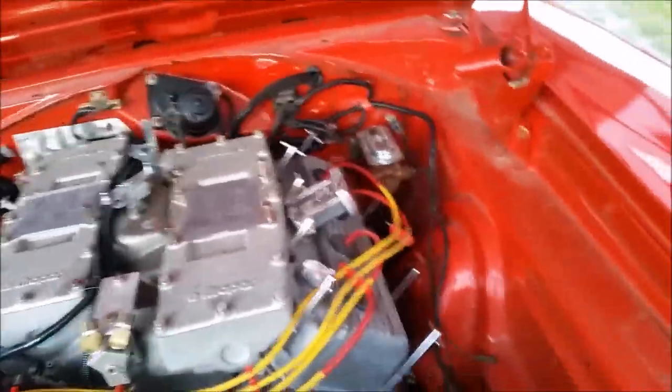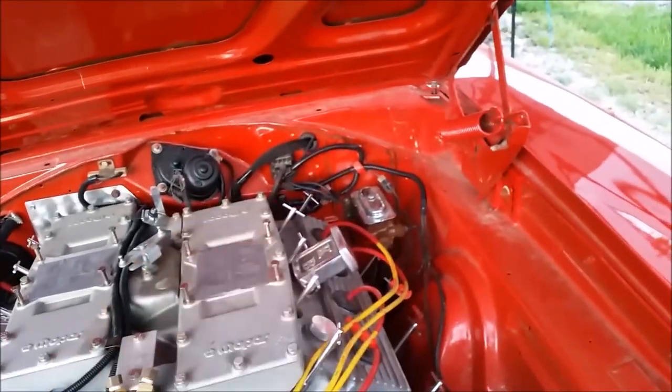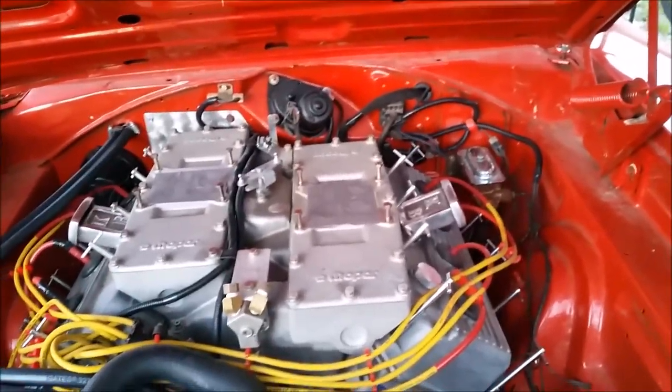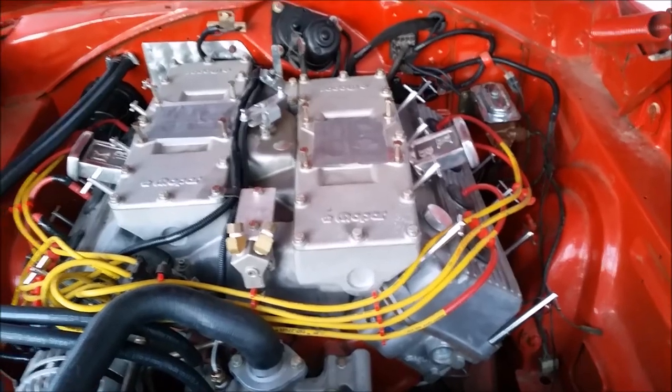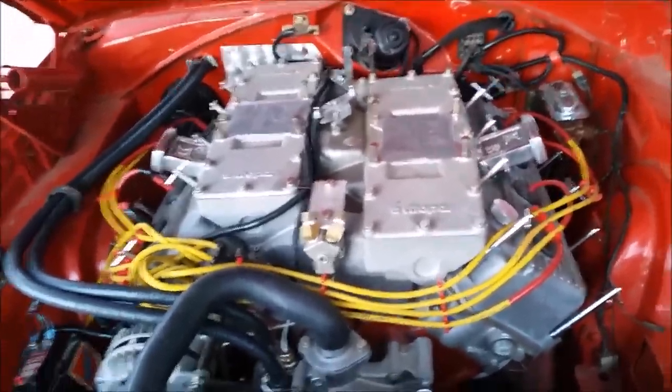It's run up through this factory wire loom area, and that goes all the way up out right there. And we actually did a test. We shorted out the starter relay and the engine cranks over good and sounds good. Almost sucked the duct tape through. But that's good. That means the engine's still good.